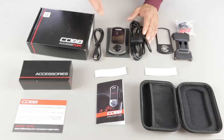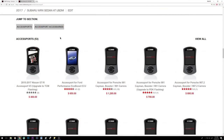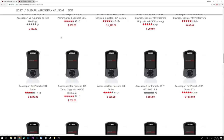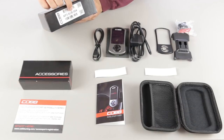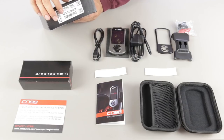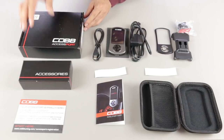Who can use the Accessport — who is it for? There are different Accessport models for different car manufacturers and even different generations within a manufacturer, so make sure you get the one made for your specific car and year. Right here the model number is AP3-SUB-004. The AP3 means this is Accessport version 3, SUB means Subaru, and 004 denotes the specific model year. Make sure you get the correct model number for your particular car or it will not work.